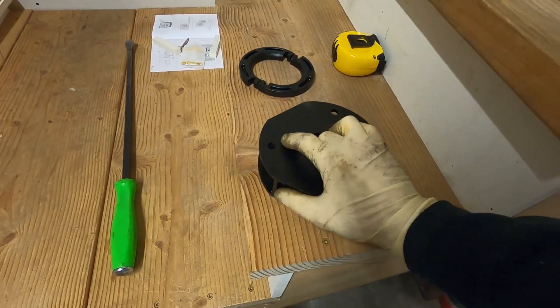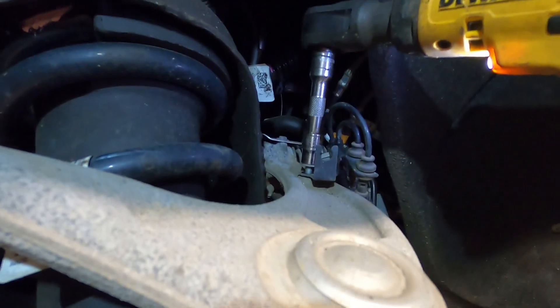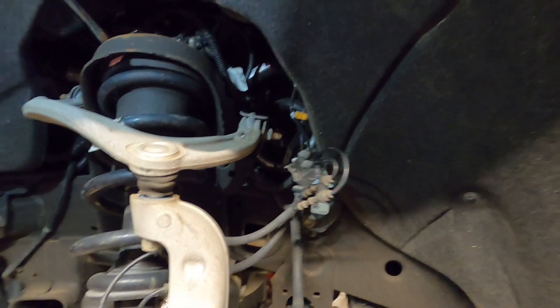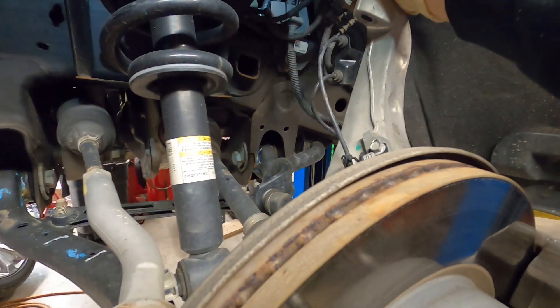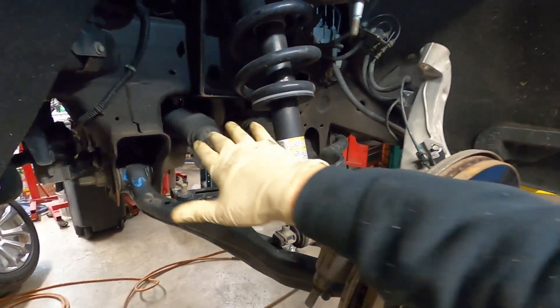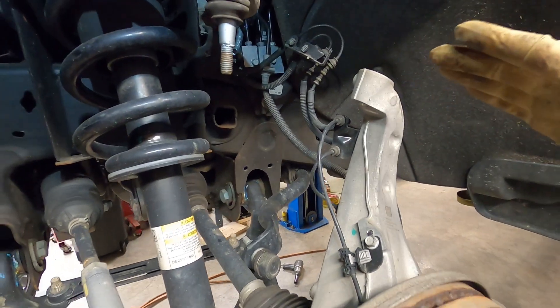We will have to do some trimming too. The bottom of this strut is two 15-millimeter bolts - those are now loose. There's a 10-millimeter here at the bracket for the sensor wires - set that down to the side. There's an 18-millimeter nut here at the ball joint, and we can gently pop that out and allow this to gently swing over. Don't pull any of that tight; be careful with your steering linkage. I'm actually going to get a bungee and bungee that back a little bit.